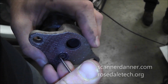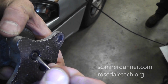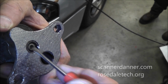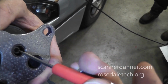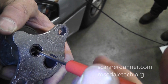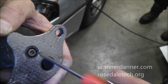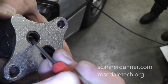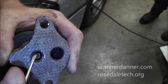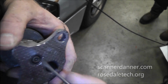And what we're hoping for is that this allows the valve to close more, because I believe that this is what our problem is. Now, some of these would also stick internally, and that is not our issue with this one. This one's not sticking inside. For the ones that stick inside, you can actually take this and spin it as you're moving it up and down, and that doesn't change the position of the pintle. That just spins the whole plunger inside, and that's where carbon deposits occur. I've shown this in another video, cleaning this, in an EGR flow video that I shot on a GM. Just trying to clean this area as well as I can to let this valve close as much as possible.